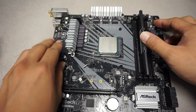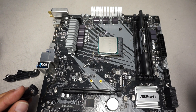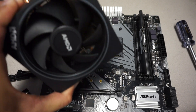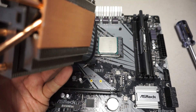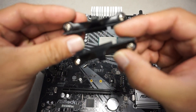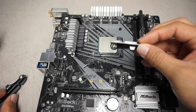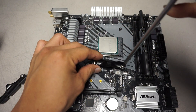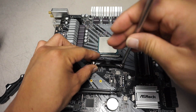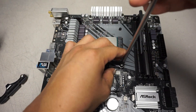I'm doing this on a bare board, so it might be a little more challenging once you're doing this inside the case. With the replacement cooler set, you'll be provided with the AMD Wraith cooler, two of the mounting brackets, and four of the mounting screws, which I've already placed on here. You can just set the screws on top of those standoffs from the back plate and screw them in right here.